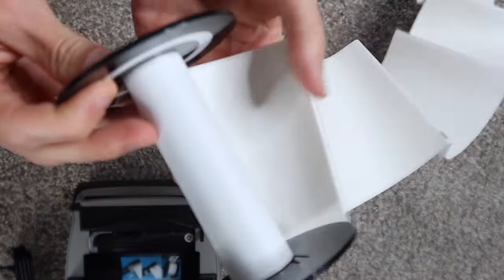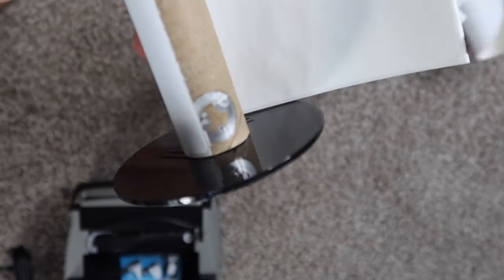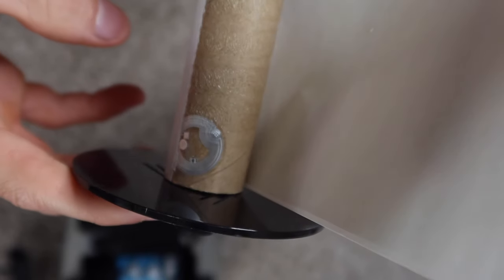I'm trying to figure out — is the printer weighing the labels? How does it know? Then I unrolled the labels and found an RFID or NFC chip on the core that Dymo has added to their new printers to force their consumers to buy their specific labels.